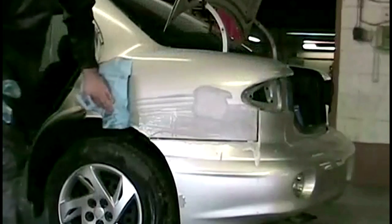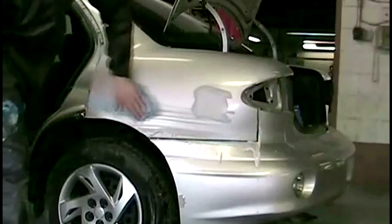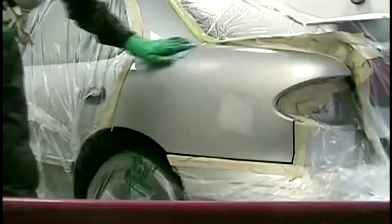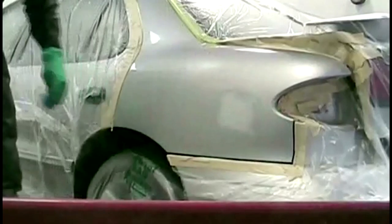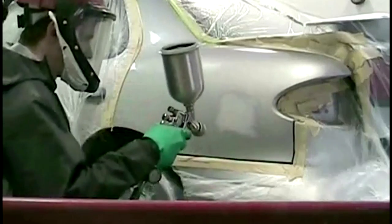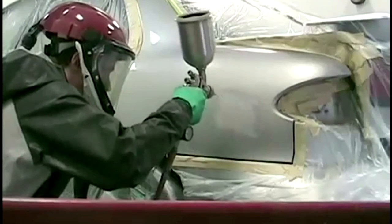This is actually my sister-in-law's car that I did specifically for a demo — my first video ever. You can see there's damage on the bumper that I just ignored. Anyway, let's get on to the next step: applying a sealer. This is sort of an optional step in most lines. It's basically a primer that gives you a little bit better foundation for your paint, improving quality slightly. Check out some other videos if you want to learn more about primer sealers and when there's a better time to use them.